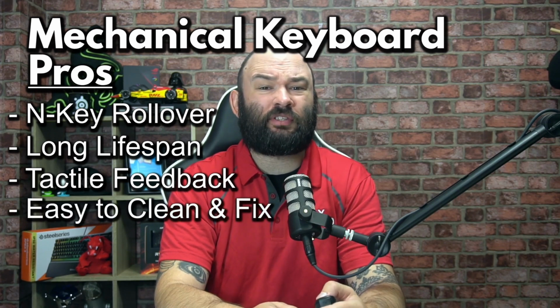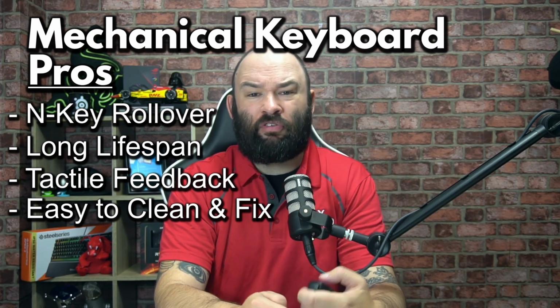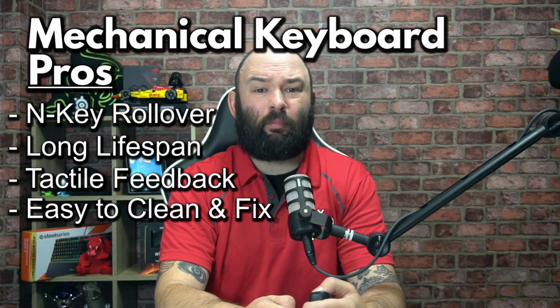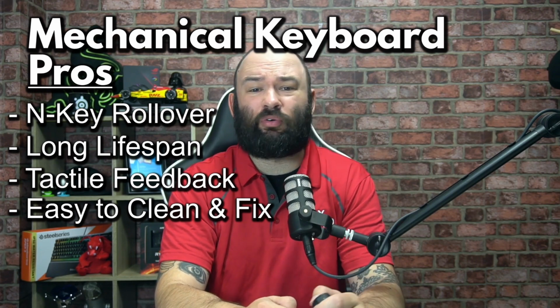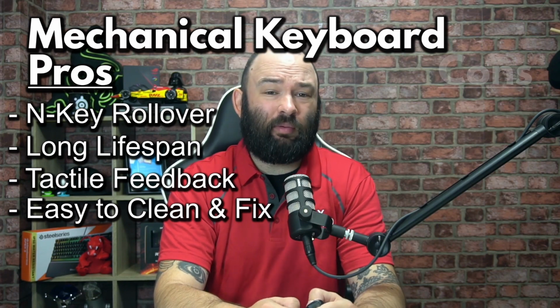Serviceable. If a fault occurs outside the warranty period with the mechanical keyboard, it can likely be repaired by someone who's handy with a soldering iron. Parts are readily available for most common faults, and replacing a key switch can be as simple as desoldering 2 points on the PCB. Now let's look at the cons of mechanical keyboards.